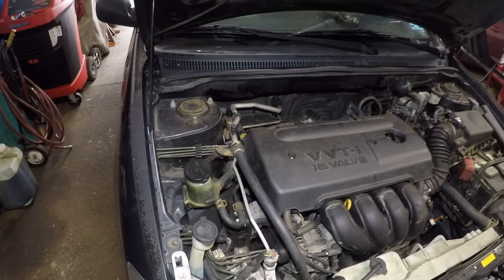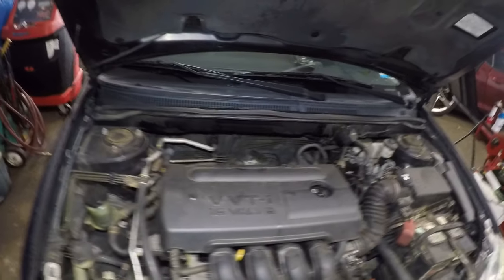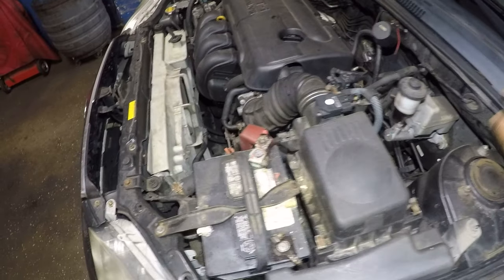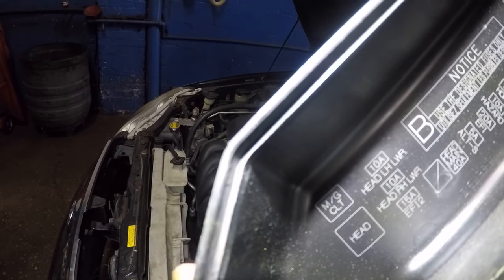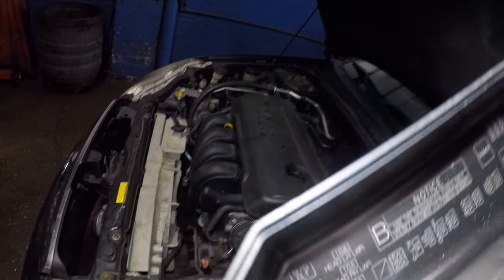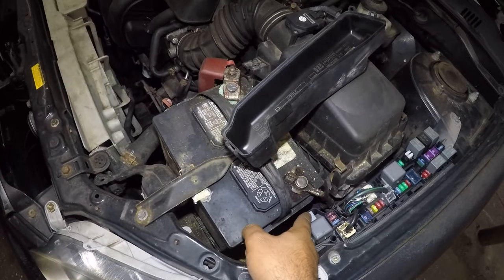Another thing you're going to do is put your AC on. This is very critical, guys — 99.9999% of the time this might be the problem on your AC system. Put on your AC system, put on the cold side. You're going to come to this fuse box right here. If you look inside, it's going to tell you 'magnet clutch' right there. You see on the top it says 'Mg clutch' — magnet clutch. That is the relay, which is located right here. That relay sends power straight to the AC compressor.